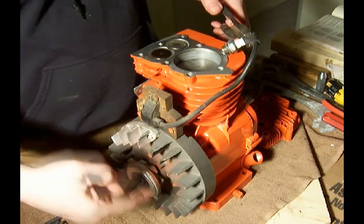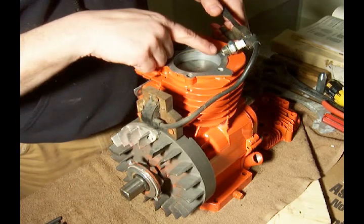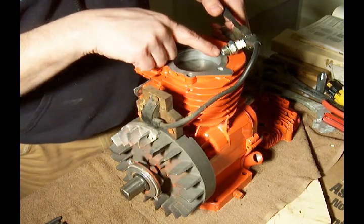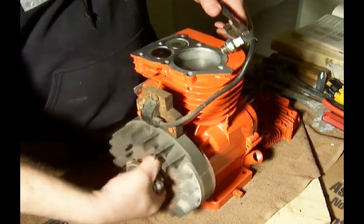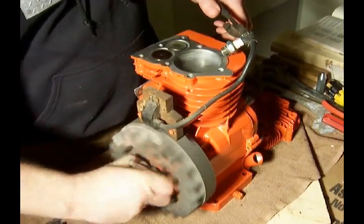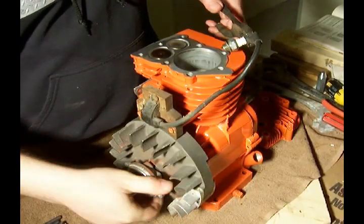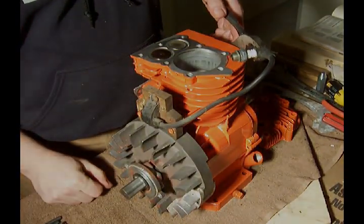What we're going to do is just spin it quickly back and forth past the coil, and there should be a spark here if this is good. Now you can't see that on the camera, but I can see there's a good spark every time that magnet passes that coil. So I'm happy with the way that's hooked up.